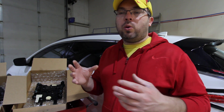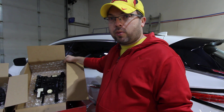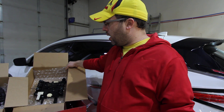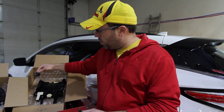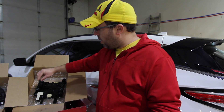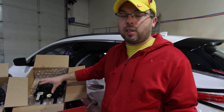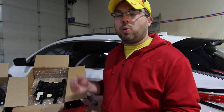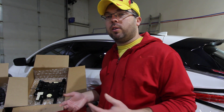What's all involved? You would have to remove the conductor plate. I've got an example right here — this is a VGS 3 model right here in this box. You do not have to include the solenoids; the solenoids just pop in and you do not need to include those. You just need to send the conductor plate by itself. What we will do is go through, unlock it, and basically clear it to virginize it. Then once you put it in your new or donor transmission, you'll be able to recode it back to your car.